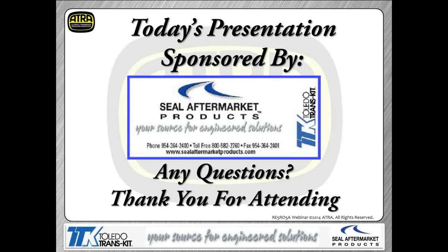Here's the chart to identify that. If you have this ID tag, like we mentioned before, this is important. That ID tag is going to tell you which ratio chart goes to that vehicle. So obviously if we have a 06350Z with that ID tag, it's going to be ratio C, or if it's this one here, it's going to be ratio A. You'll notice that some of these on the 2-wheel drives may have 2 different ID tags, but they both still take the same ratio. And the same thing here in 4-wheel drive. There will be some models that will have 2 different ID numbers, but still take the same planet ratio.